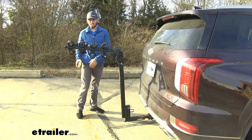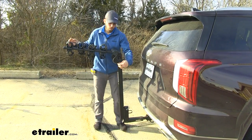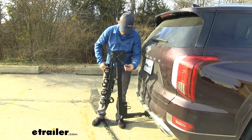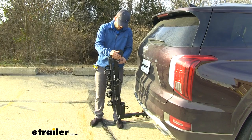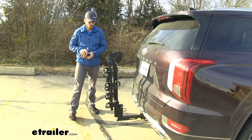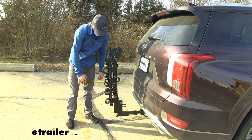If you want to take away some of that space, you can actually leave this installed on your Palisade and fold down these arms by removing this pin and clip, folding those arms down, and then replacing the pin. Just like that, you can see we take away a lot of space. You can travel with it in this position. Measuring again from bumper to the outermost point, it's about 17 and a half inches — so it took away a lot of space.